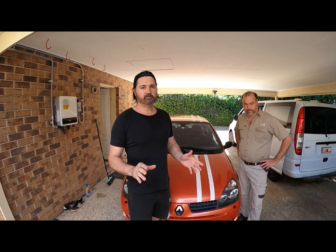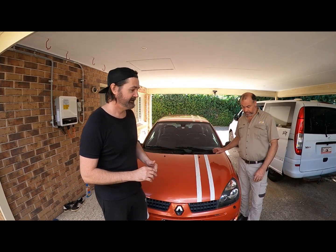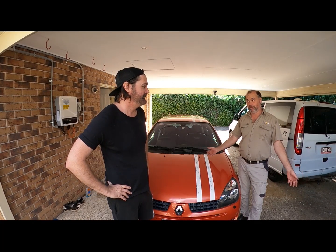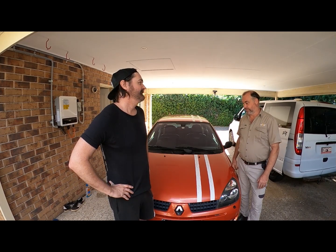Judging by the service history on the car, the plugs have probably never been changed. So what are we going to put in? I'm going to chuck in a set of plugs. I've got a set of leads as well, because you're in there. The leads are 20 years old. They sandwich between the alloy manifold and the alloy head. That's pretty much why you do them.